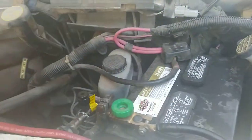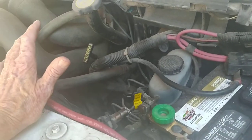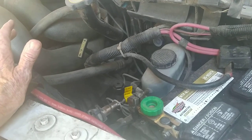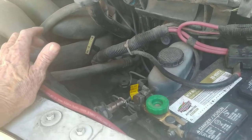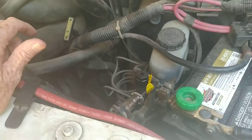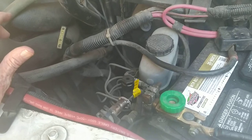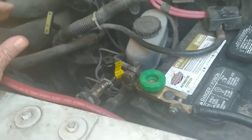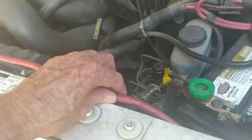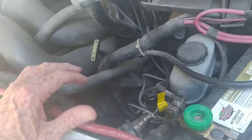There was another problem I had here a while back because I don't drive it much. If you let them sit more than a couple of weeks, your batteries are going to die. So I put this disconnect on — bought it on Amazon. You just unscrew it a certain way, a few dozen or more turns, and it'll break the connection to the cable. Now that I have this connected to this ground and not the frame, I can disconnect both batteries instead of just one.